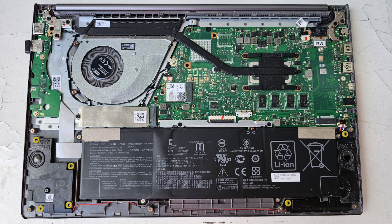The fan is also removable. The laptop issue was likely caused by a drop — there's probably a crack in the motherboard or the SSD connector. When holding the laptop up by one corner, the weight causes the case to arc, with the high point where you're holding and curving down on the other side. That was causing the laptop to go to BIOS and not detect the SSD.